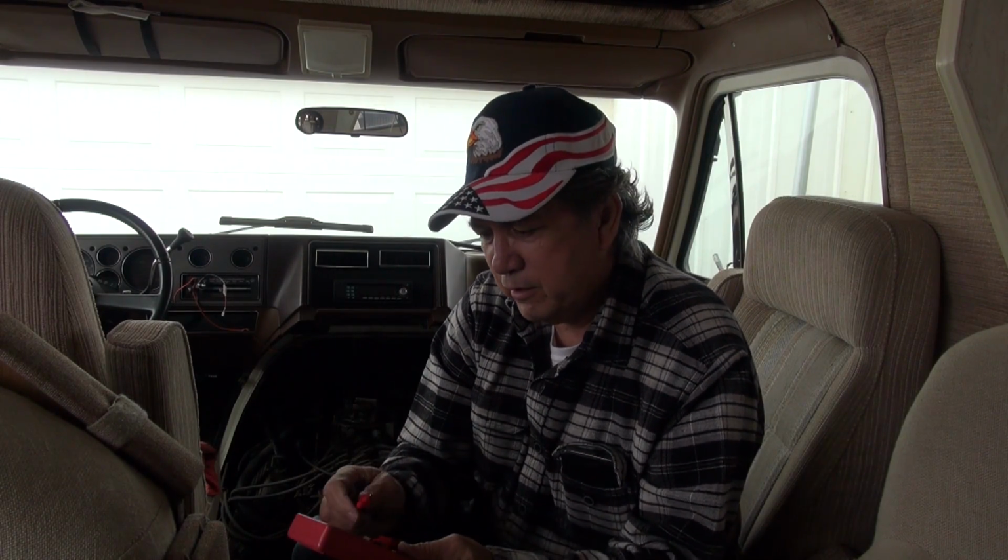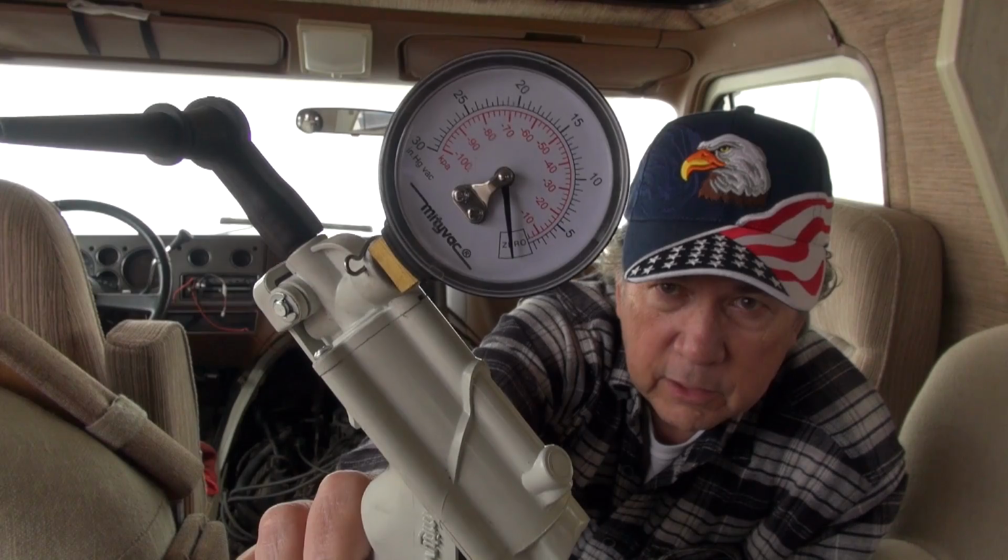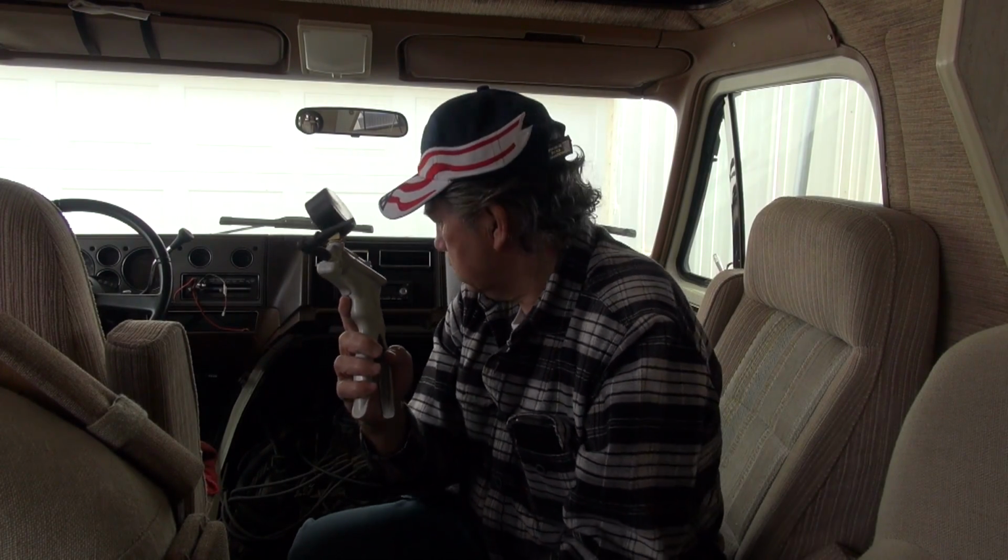So that was the fix. It's actually $120 after all said and done. And then I could read the voltage, and what a difference. That made it run better, but it didn't fix it. So it was still, you know, awful smog. So then I thought, even though that MAP sensor is only 2 years old, I need to test it. So I got my vacuum tester. Everybody has a vacuum tester. I think this is Harbor Freight. I forget the price. So I tested the vacuum on the MAP sensor. The vacuum there holds good.